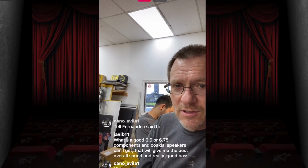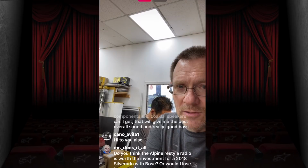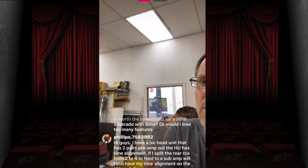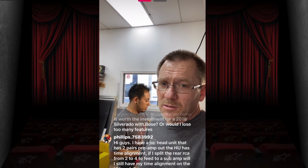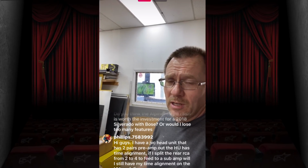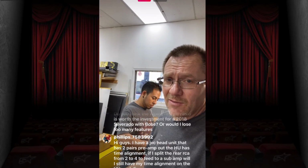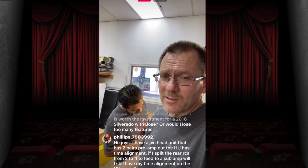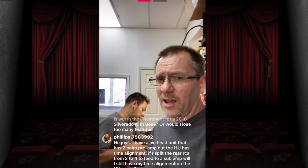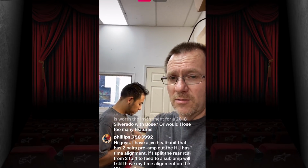Bye. What's a good 6.5, 6 3/4 component and coaxial speaker I can get that will give me the best overall sound quality and really good bass? I mean, that's kind of a loaded question. The more money you spend on a set of speakers, the better the mid bass is going to be, just because it's a better designed mid bass. The less money you spend, the less you're going to get. The only exception to that rule is if you check out the Kenwood Excelon 7-inch components. Because it's a 7-inch, you get a lot more mid-bass out of that driver because of the bigger driver. It comes with a 1/2-inch adapter, not even 3/8 or something like that, that allows it to fit into a 6.5 location. So as long as you don't have front depth concerns, you're good to go. You can pick up one of those and it'll be really nice.